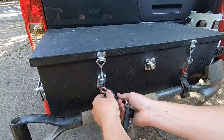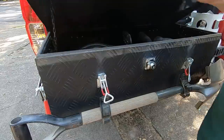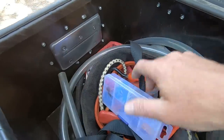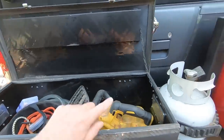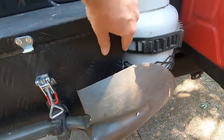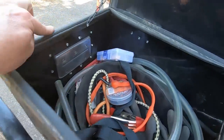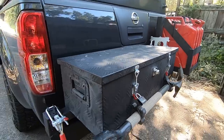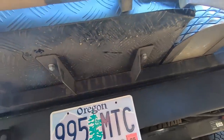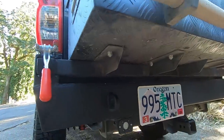In this toolbox I'm carrying my chainsaw, some recovery gear, my gasoline siphon, and just some other odds and ends. This toolbox came only with really thin weather stripping on it. It does fold down over the top so rain theoretically should run off, but I added extra weather stripping inside as well. The toolbox kind of looks like it's awkwardly suspended out over the back, but it is mounted on some pretty beefy braces made from eighth-inch thick two-inch by two-inch angle. For the very little weight this box is carrying, I'm pretty sure it is well overbuilt.